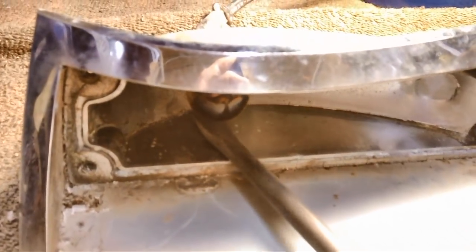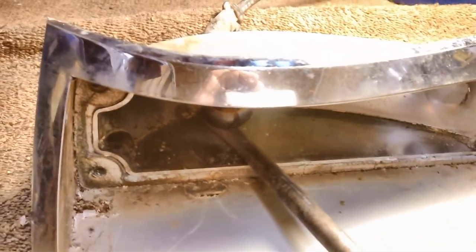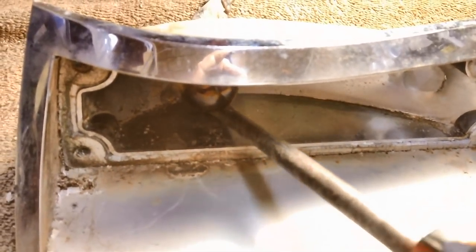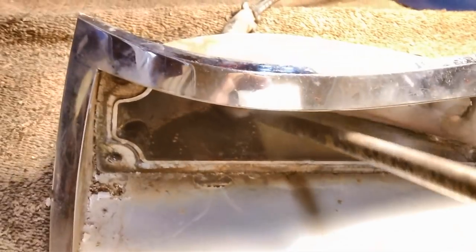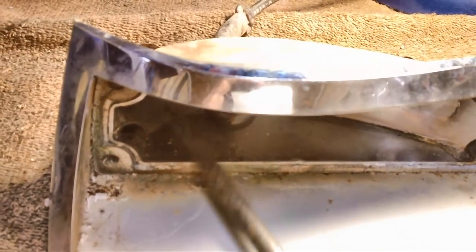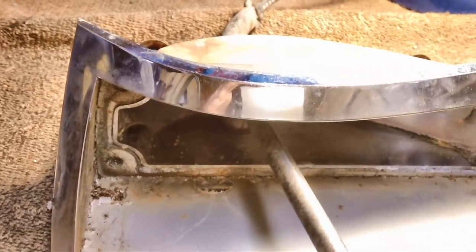So here's the best way to do it that I've found over the years. You take whichever side of the bulb is closer to whatever it's in. Get your screwdriver in there underneath like that, a big one, not some skinny little thing, and just kind of lift up. If you're lucky, it'll start to come loose. Then you go to the other side, and you go down, back and forth, back and forth. It's a two-hand operation, but you get the idea what I'm talking about.